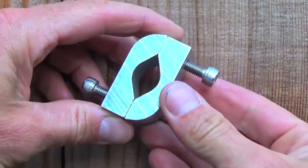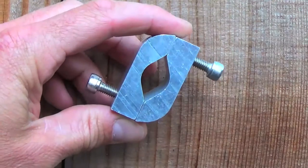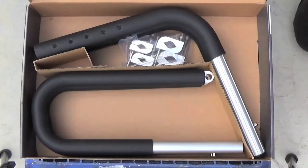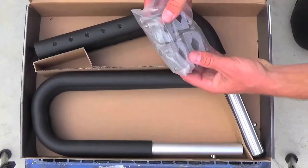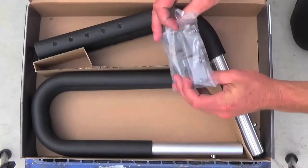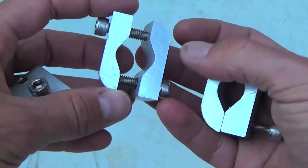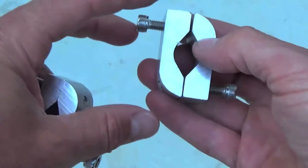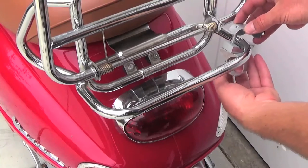Make sure you tighten both clamp bolts together so that the two halves of the clamp blocks stay parallel to each other as they are secured. If you find that the clamp blocks are too small to fit around the bars of your moped rack, there are two sets of larger blocks in the accessory pack located in the box. The smallest clamps cover a tube range of about a quarter inch to half an inch. The medium size covers a range of about half inch to three quarters of an inch, and the larger size covers a range of about five eighths of an inch to one inch. Use the smallest size blocks that fit your moped rack bars.